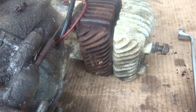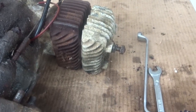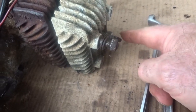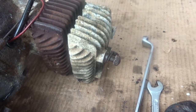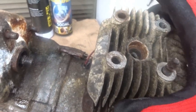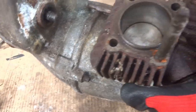The next thing I'm going to do is take the head off to get the piston off so I won't damage it. I managed to get the plug unscrewed — you can see the trouble I had with it, it was absolutely rotten. Two bolts were in very bad condition, the other two are okay. I've undone that bolt there and I'll have to try and get this one out with vice grips or something. It looks in reasonably good condition, just needs a good cleaning, and the bore looks pretty good — no scoring.